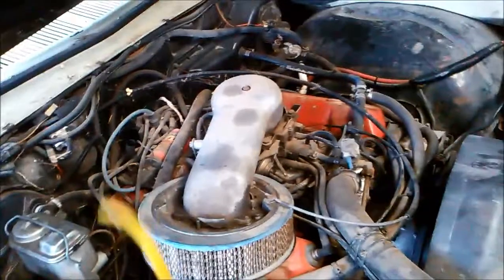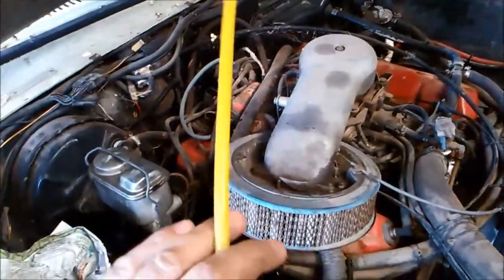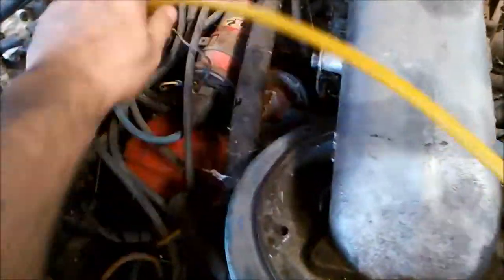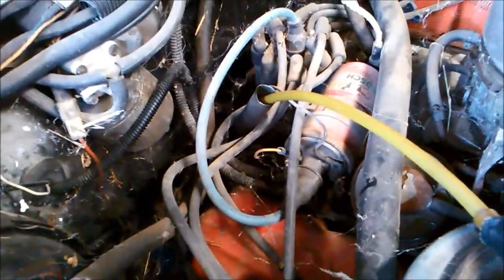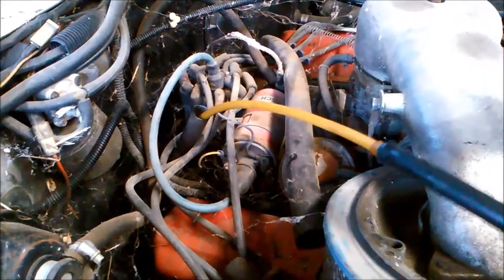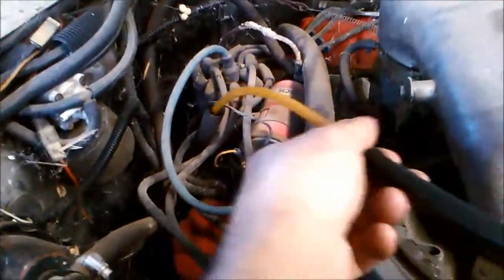As usual they don't have a drain plug on the transmission, so we've got the vacuum pump. We just stick the hose in there and give it a bit of a twirl, because sometimes it hits the top of the valve body. You can see the hose has darkened where it's sucking the oil up. There we go - you can see it's sucked all the oil out and it's starting to suck a bit of air.